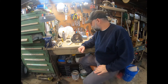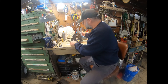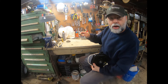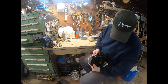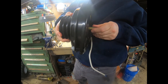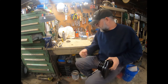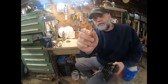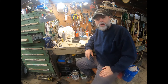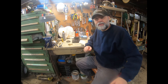All right guys, well that worked out really well, I'm pretty pleased with the results of that. Here's the bolt that's gonna go in the clutch — we ran it down so all the threads went into the crank. If we put this in here backwards you can see it's just all threads, so we know we're not gonna bottom out before it starts holding the clutch. Plus we also have the thick washer as another cushion as well. So boom, another part done to the project, and next time we will make the motor mounts for the Wisconsin. Thanks for watching guys.